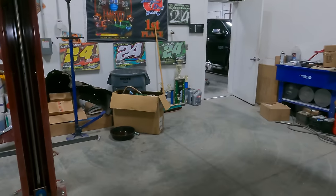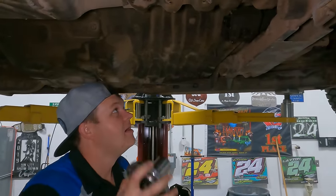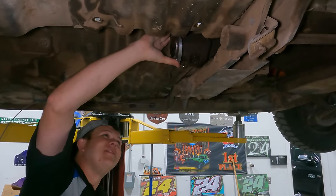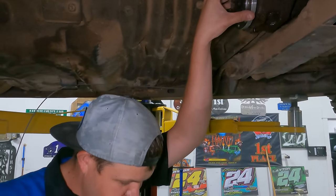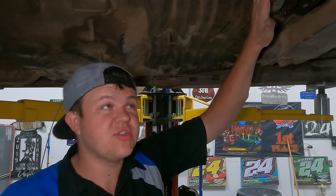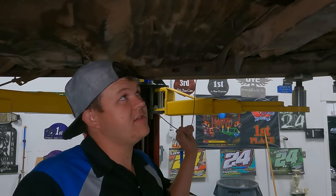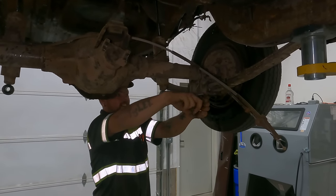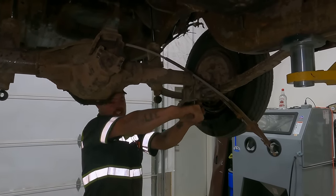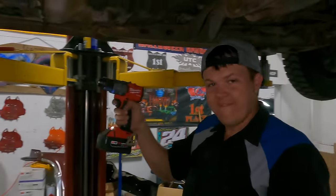Holy cow. So we sent our tow truck driver today to Nephi, Utah, and got us a bolt on. Oh. Yes, it fits. So this is a bolt-on tail shaft so that we can put on a slider drive shaft. I nominate you to be the one to drill the hole and tap it. Okay, well, I'm not scared to drill that. They're tight. Very tight. Check it out. Got me a new drill. Non-sponsored. I just love Milwaukee.